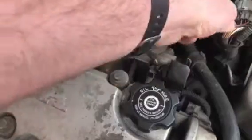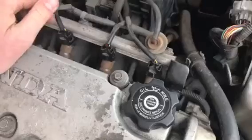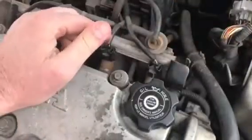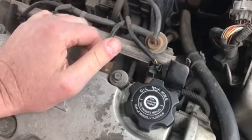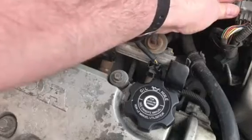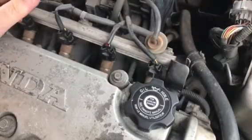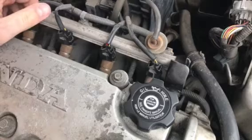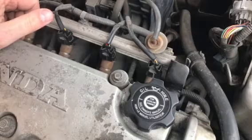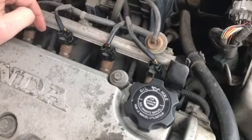As you can see, a lot of these wires are out there and you can chase them back. But be careful on some of them because as they go through their route back to the ECU, they can change after a plug connection. So just make sure you're still following the same colour wire. Not so much on this car - it seems to be the same as it goes through. But just bear that in mind when you're chasing wires trying to find an open circuit.